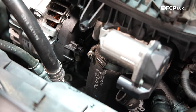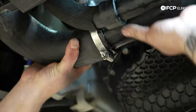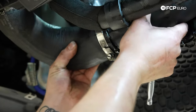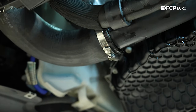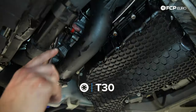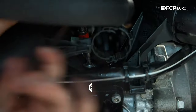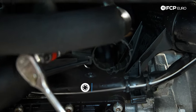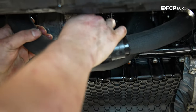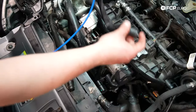We're going to plug in the sensor and tighten two bolts. Slide the intercooler hose back to the charge pipe and tighten the seven millimeter — always pull on it to make sure before you go and drive, it doesn't fall off. Install the T30 right behind the map sensor. Before fully tightening, start the other T30, get it tight by hand, then go back to the first T30 and fully tighten. Now plug back in the map sensor, then put the coolant line back into the bracket.